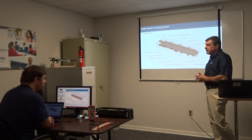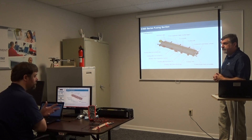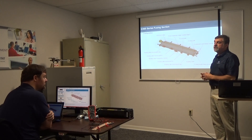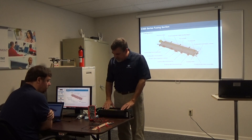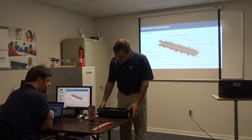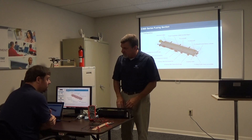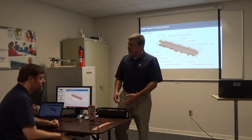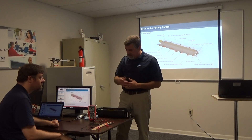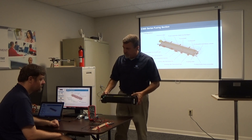Do you have any questions about any of that? Can any of those parts be replaced individually, or do you just replace the whole unit itself? Great question. On this series, we have the whole unit — and this is a unit here that I've got out for you. The whole unit comes out as a whole piece if you have a trouble with a thermistor, or if you have a fusing claw break-off, something of that nature, or a nick in the belt that's giving you some copy quality issues down the page. So this unit will come out as a whole and be replaced as a whole.